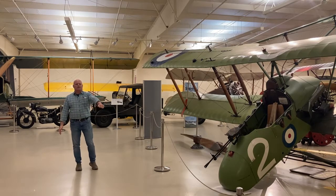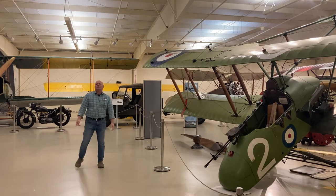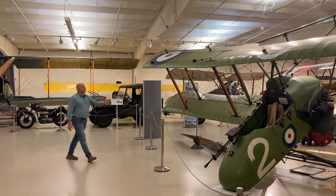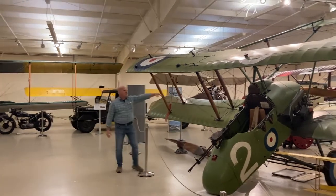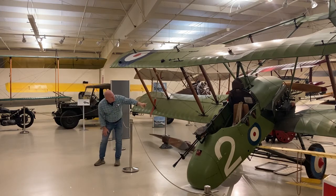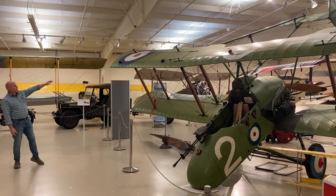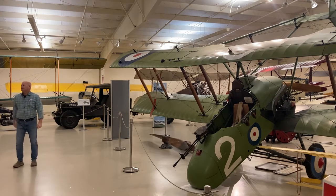It really needed metal tipping on it. If you notice these ducts — it's got a modern 1950s engine. Those air-cooled cylinders really cooked going through the desert. When they got it here, Grady Sharp, one of the volunteers who did all the engineering and construction, put all this ductwork and baffling on to cool those cylinders. That has nothing to do with the original. Originally it had a rotary engine — like that cup over there, which we actually have out in the lobby.